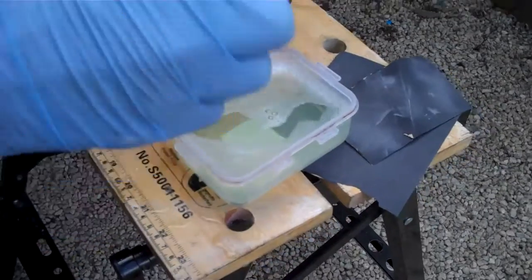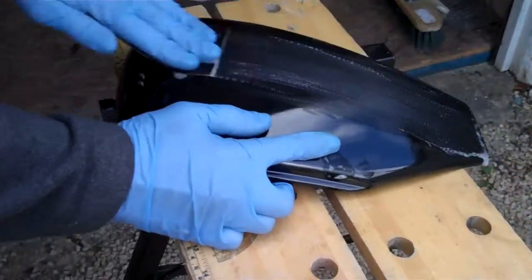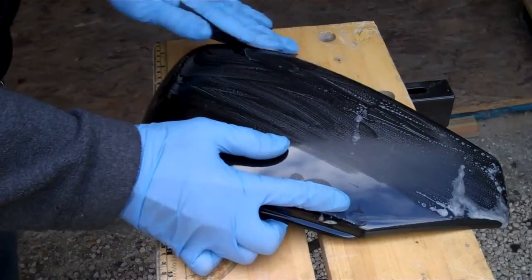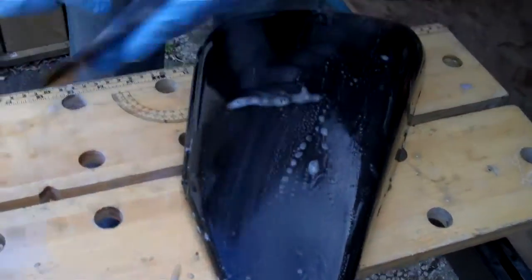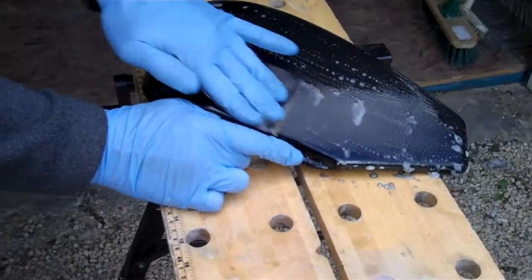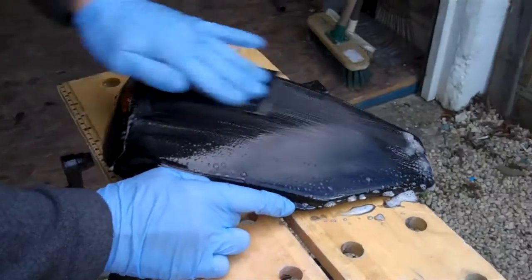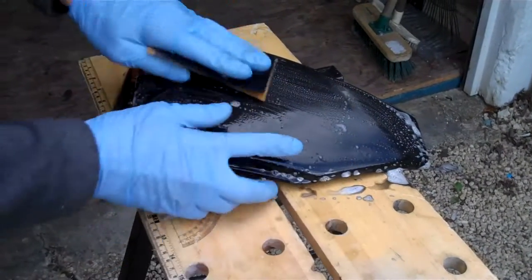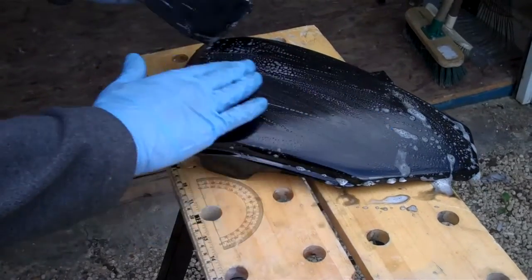This is just hot or warm soapy water with loads of washing up liquid. Washing up liquid is a brilliant degreaser — it dissolves off all grease and wax. Get it nice and wet, and work in straight lines like we said yesterday. You can feel the paper biting into the gloss and taking it off. Keep lots of water on it — keep washing the grit away so it doesn't bung up into little beads, clog the paper, and make scratches. Take your time, don't lean on it, just feel it. The little marks, you can feel them with your finger. I'm wearing rubber gloves just to keep the grease from skin off it. Wherever you see a little mark, just rub it and gradually take them all out.